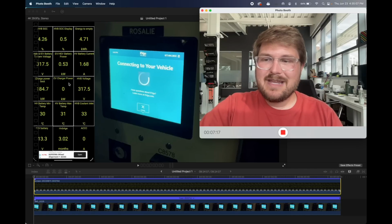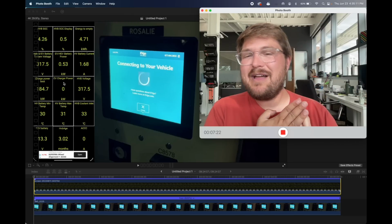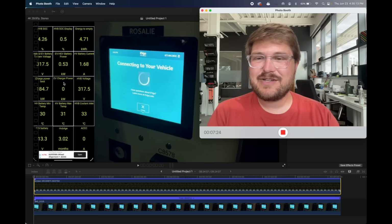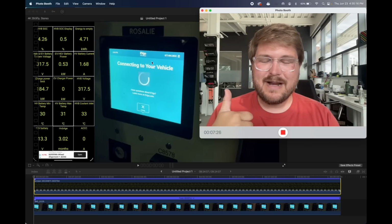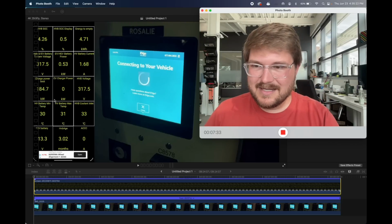This number just below, the EV charging power, is what's coming into the port on the truck. So there's three different values we need to look at when DC fast charging. The first is, what is the charger outputting? And it'll show us that on the EVgo screen. What's making it to the inlet plug on the truck? That's what this number is going to be.